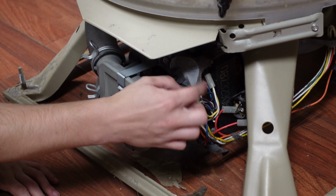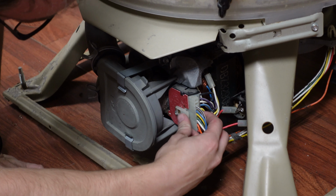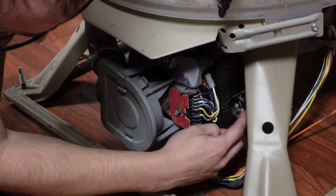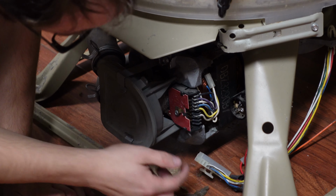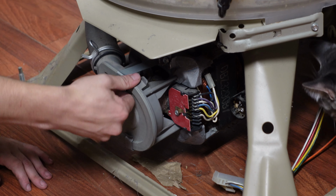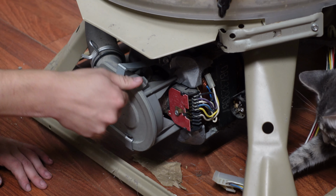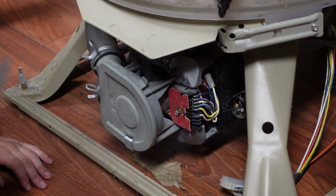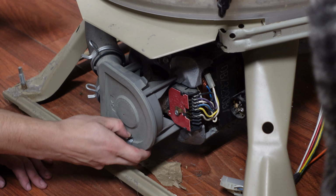We gotta get behind this motor. So first thing we're gonna do is unplug it. Oh, and I already left it unplugged, but you also unplug this solenoid over here. So that solenoid's unplugged, the main motor connector's unplugged. Now, we gotta undo these catches here. And once these come off, rotate them 90 degrees in either direction and they'll pull out so that you don't lose them.